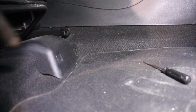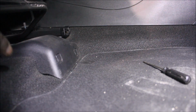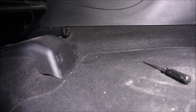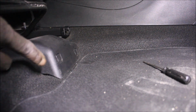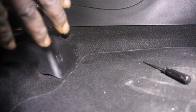We're over here. There is the place where the airbag is plugged into the car. Before, in my case, before I'm going to plug, disconnect the airbag, I've disconnected the battery first.